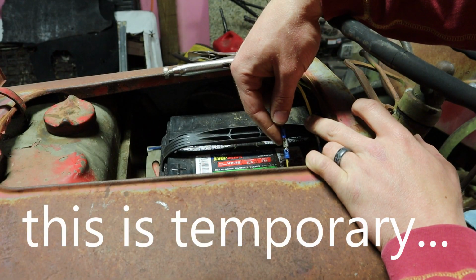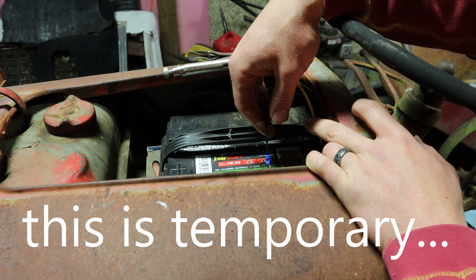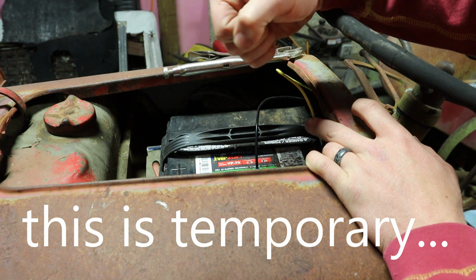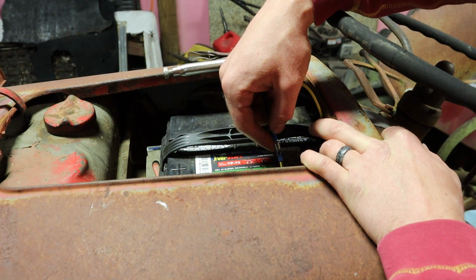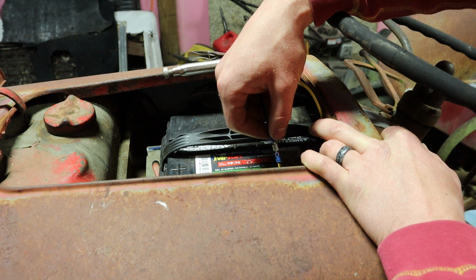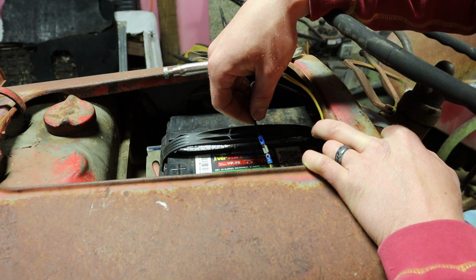We're just going to tap into where it's switched on. That way that's going to be our power for our headlights, and then I will just leave the headlights in the on position. The idea here is just to have the headlights on, that way it's like a dummy switch, and hopefully I won't forget ever to take the key out of the ignition again.